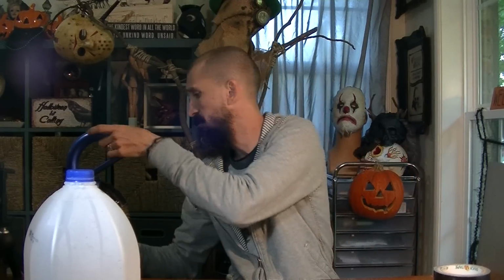Another rule is your vacuum cleaner is meant to have airflow from the intake where it vacuums and out the exhaust port, right? It's supposed to be moving air, and along the way it takes the dust out of that air, right? It's not meant to be stuck. So if you put your hand on this and let it be stuck, you're going to burn your vacuum, right? So when we vacuum form this skull, you're going to be pretty much stopping the flow.